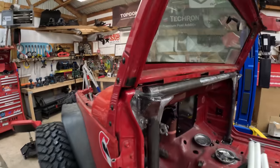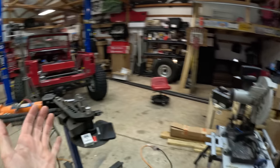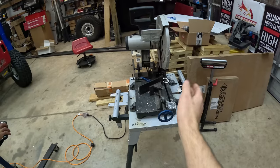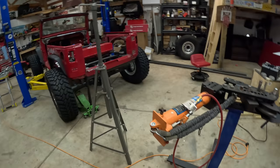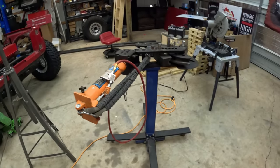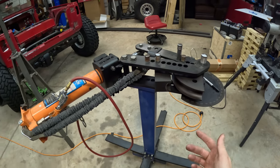Our stanchion post plate is all boxed in on both sides. Before we dive into the main dash hoop, let's talk about the tools needed to build a roll cage yourself. First is a nice chop saw - we have the Evolution chop saw with the stand, cuts through metal easily with miter capability for angled cuts. Second is naturally a tube bender. There are manual ratchet benders, air-over-hydraulic, electric-over-hydraulic - lots of types depending on how much you want to spend. Tubing dies are also important and usually run around four or five hundred dollars per die set.